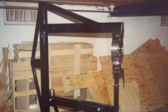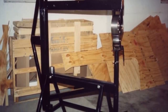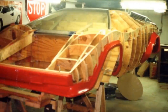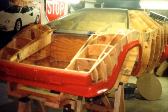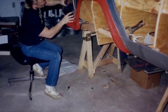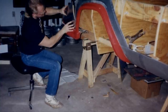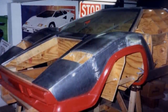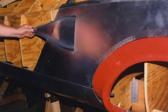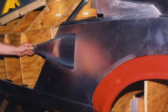This is an English wheel — a tool used to bend and shape metal that he used quite a bit during this build. He created a wooden jig to help him bend the metal for the car and create the iconic perfect angles. He uses the English wheel to manipulate the metal into the shape of the jig. This process is incredibly difficult and is done entirely by eye and feel. After each section is complete, he welds pieces of metal together on top of the jig.